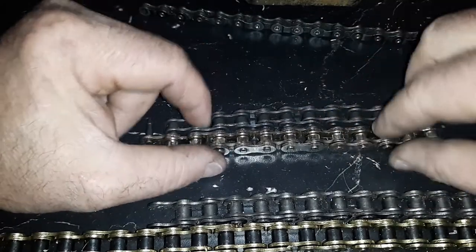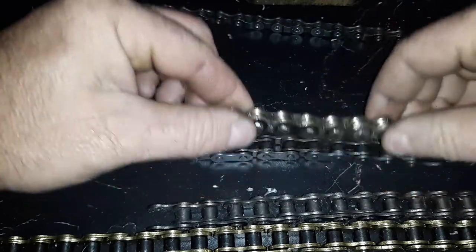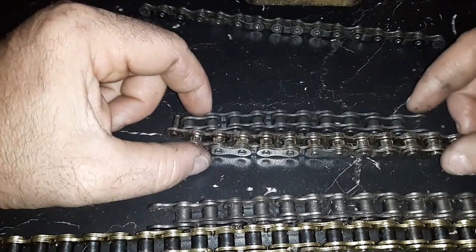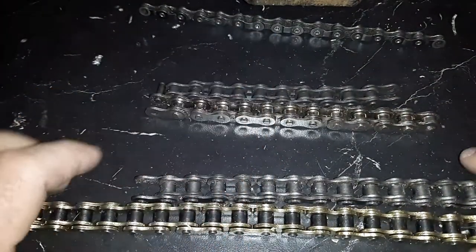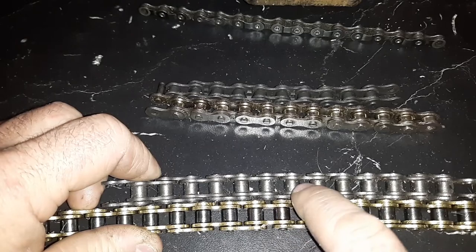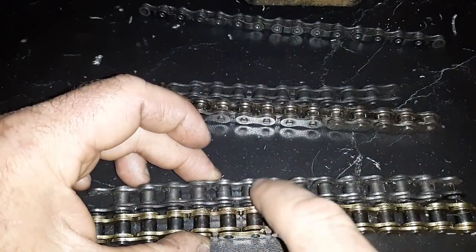The thing that is a little different on some of the Chinese ones, as we can see, it's just ever so slightly a little wider, and that's because on the Chinese ones they usually just use thicker plates and whatnot. So in general, they're always a little bit thicker, but it really shouldn't affect anything. If it fits 415, either one will work. And if you got a 420 chain, same thing. As you can see, these plates are slightly thicker than the standard one. But when you put them side by side, since it's only this internal section that matters,